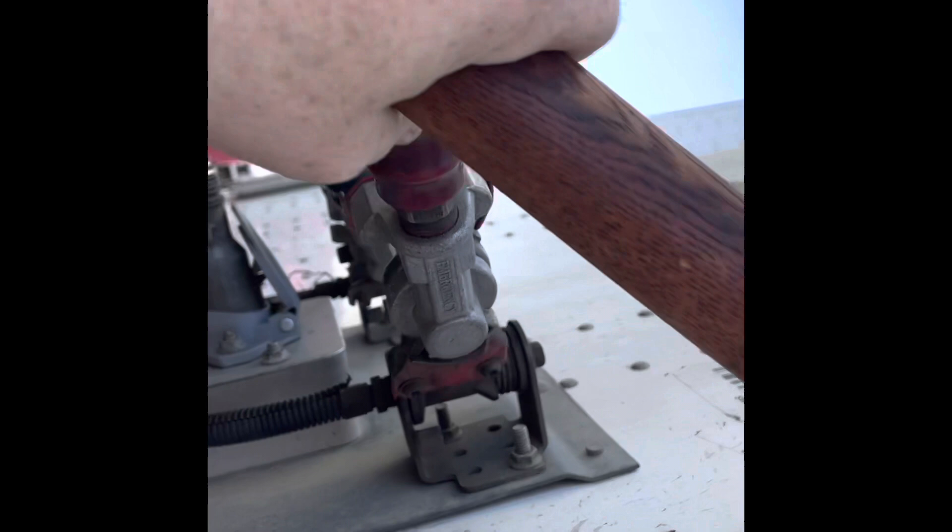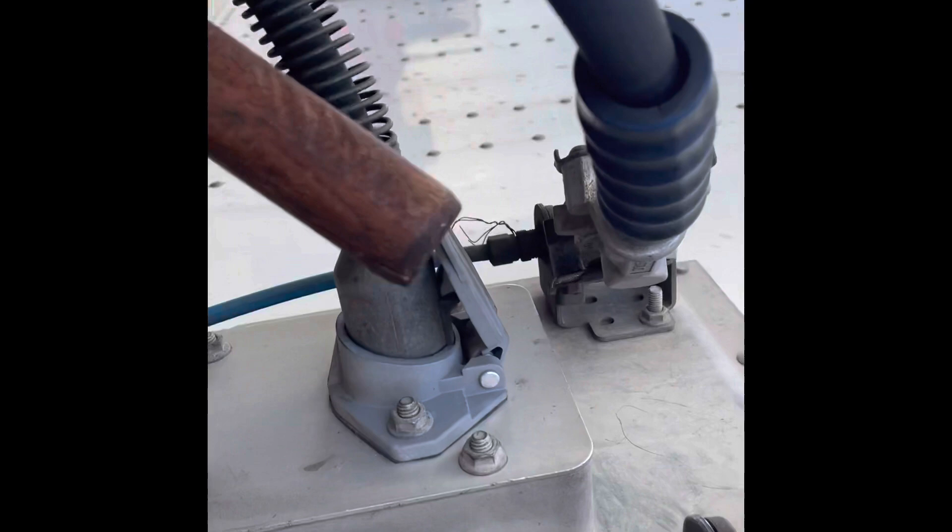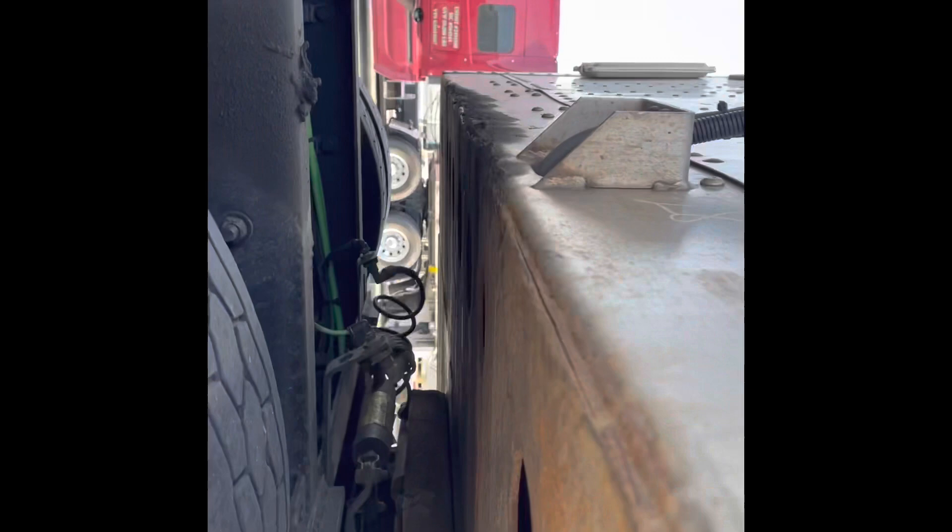We're checking our glad hands, making sure they're flush. Up between the two metal connectors there should be two rubber grommets — make sure they're not frayed or decaying. On your catwalk, make sure you don't have any leaking, and check that there's no gap on the apron between the fifth wheel and the trailer.